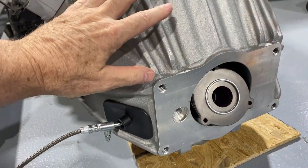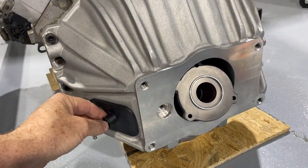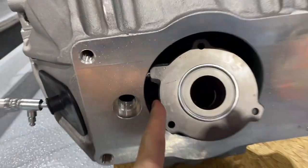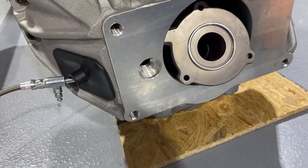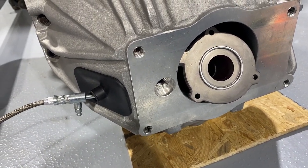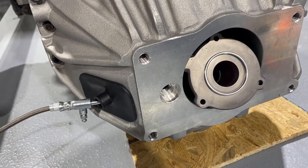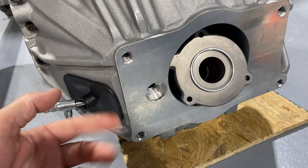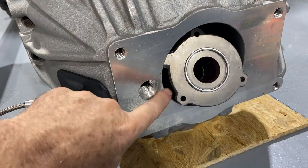Before assembling the bell housing back onto the LS motor, we had the throw-out bearing and we had to put the dust shield in place and run the hard metal line through that dust shield into the throw-out bearing — you can see there, it's attached right there. Otherwise there would be no way to do this off the car. If you had the engine in the car and didn't have the bell housing on, you'd be in a predicament because you cannot put your hand in there to attach the line to the throw-out bearing — it's too small of a hole, and even if you could you've got all the clutch assembly in there.